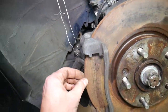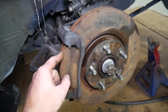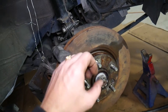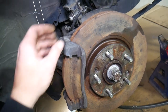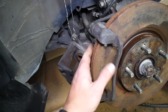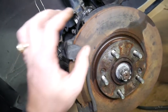What is the number one symptom that you need to replace your brake rotors? Pretty simple: if you hit the brake pedal and you start feeling pulsation in the steering wheel — the car is vibrating — you need new rotors. The faster you go, the more the car will vibrate. At 60 mph you may barely feel it, but at 80 mph it shakes like crazy. That is a sign the rotor is not even — it's warped. That pulsation transfers from the rotor to the steering knuckle and through the power steering, shaking your steering wheel.